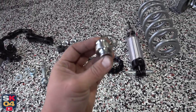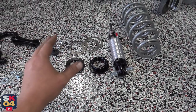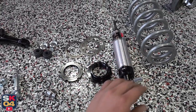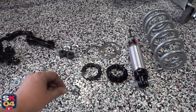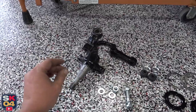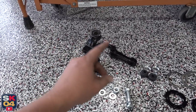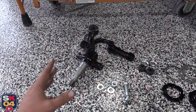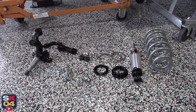This lower perch design is for use with a factory-style lower control arm, but since we have QA1 tubular arms we have a different bearing bushing setup that needs to go in the very bottom. So we'll take out the seat clips, replace that, then start putting on the spring seat, the lock ring, and we've got these needle bearings that sit between the spring and the spring perch to make adjustments really fluid later on. We have the bushings that go up into the frame, the hardware, and the factory drum brake spindles — though you can also use disc brake spindles. All of this has been blasted and powder coated, so it's all very clean.